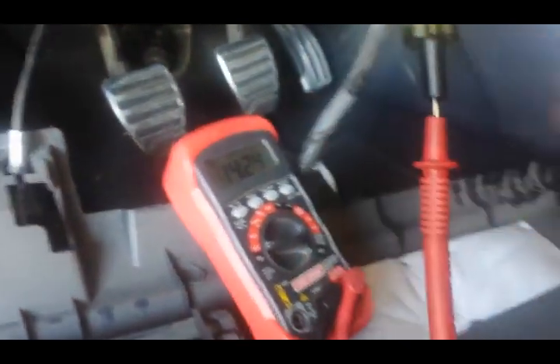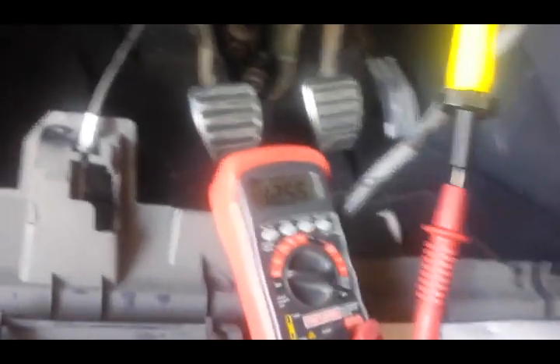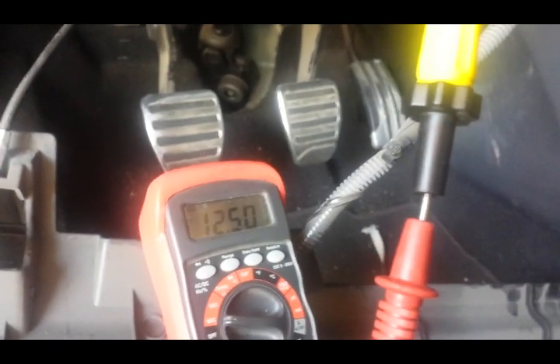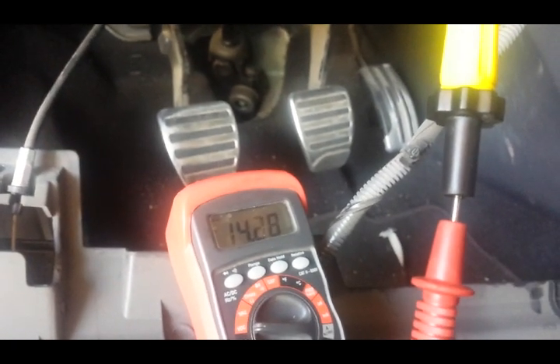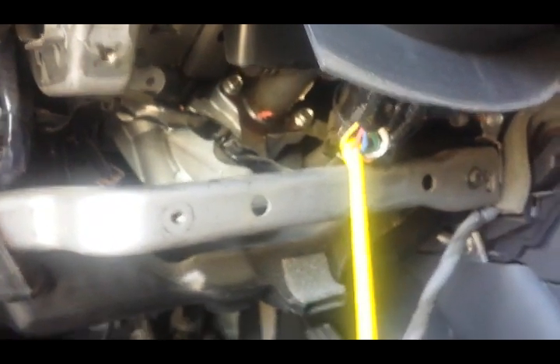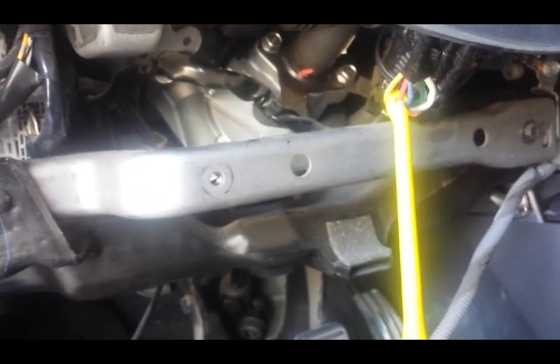I'll show you the same thing on the multimeter — it might be a little trickier to read, but you'll get the idea. The car is running at 14 volts, turn it off, turn ignition on, and crank the car — it's gonna drop to zero again, then goes back up to 12. So you'll know that is not true ignition. Stay tuned for the next video where I'll show you the starter wire and a couple tips about that.